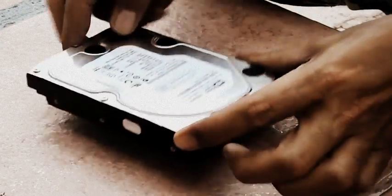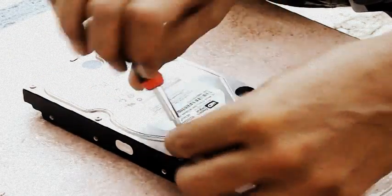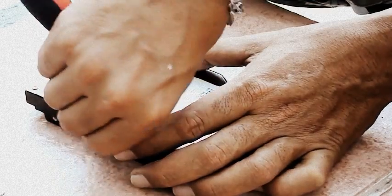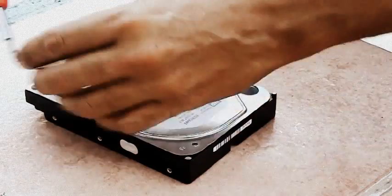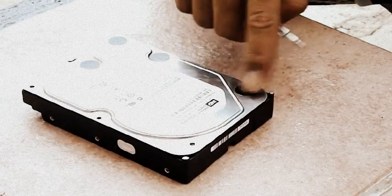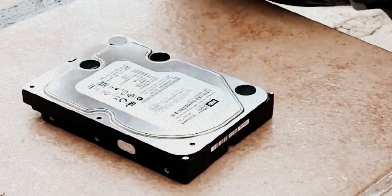Now let's get to the really good part — let's get inside the hard drive. You need to open the top cover and take out the screws. Remember each screw position, because if you put them back wrong you'll leave the cover open and the hard drive can get dust inside and get damaged. We got three screws here, and a couple more screws under the stickers. Let me check first where the stickers are and I'll be back in a couple of seconds.